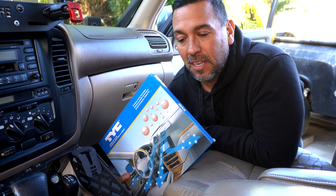We're going to take out this plastic grid right here. There is a screw right in here, one in this gap, another one here, and another one here. That loosens this plastic cover off. Be careful — I believe this is an airbag sensor here, and you have your dome light here. Pull this out like this; you can leave it to the side without disconnecting it, just for demonstration purposes.